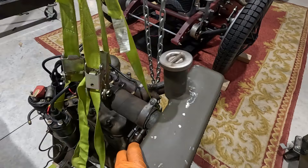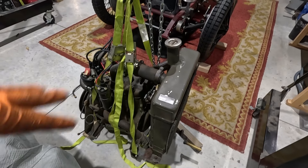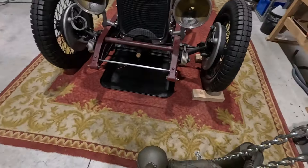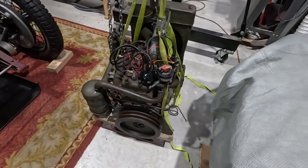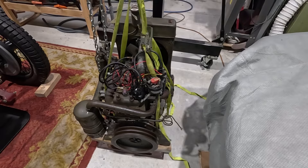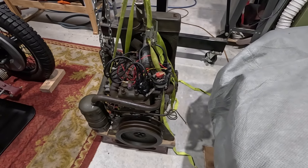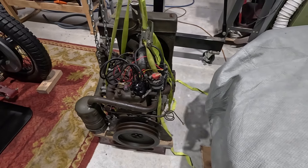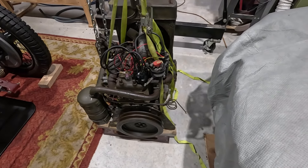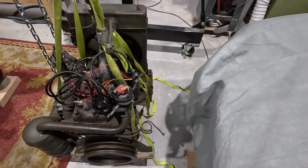The A28 might be just a little too tight. The A-series belts go 28, 29, 30 in increments which might be too much, so I'll see how this one goes — there is flex there so I think it'll be alright. I made sure the radiator isn't anywhere near the fan and gave it a wipe down with an oily rag while I was in there. Hopefully the distributor runs true now with no wobble — I was very careful machining it to keep it as concentric as possible, using a steady at the end.